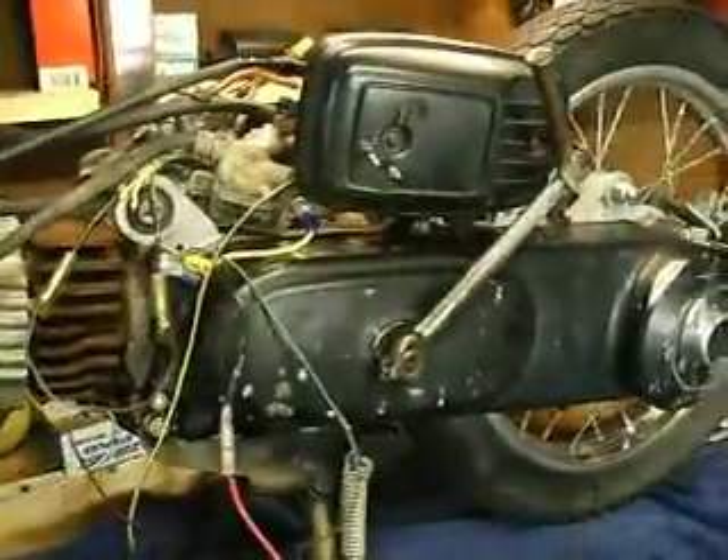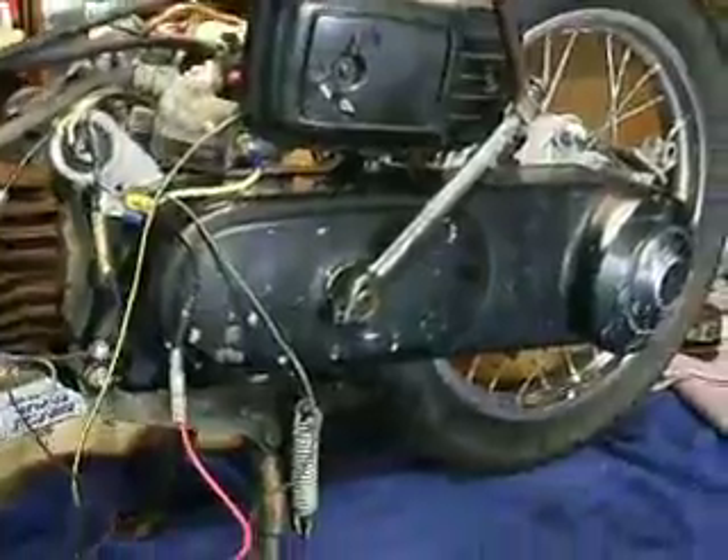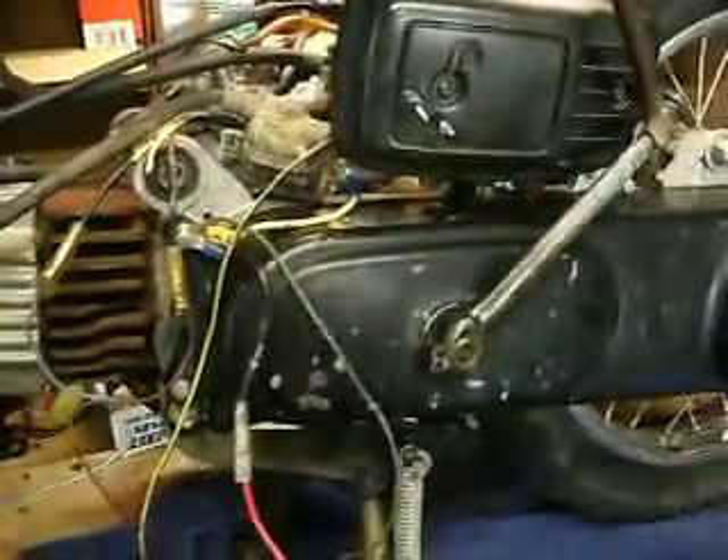This is to show how to run an express motor — urban, regular express, whatever — with no battery and not hooked up to anything. What you have to have is the coil, and on a CDI engine, you have to have the CDI unit itself. You also have to have an inline switch to shut it off, because otherwise it'll just keep running.